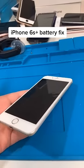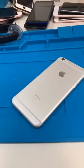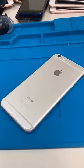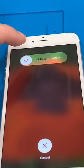A customer brought this phone in. She said it was dying way too fast. It's an iPhone 6S Plus — an aged phone — so we're going to get the battery swapped out, starting with the two pentalobe screws on the bottom of the device. Make sure it's powered off first.